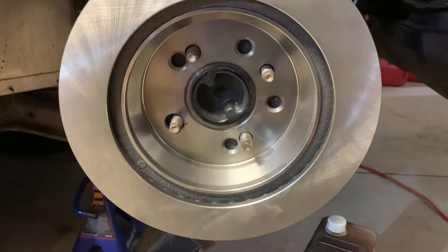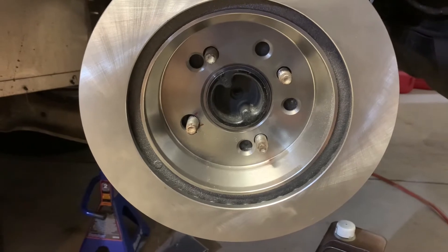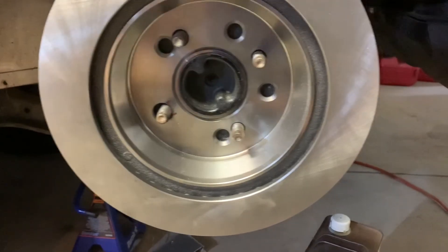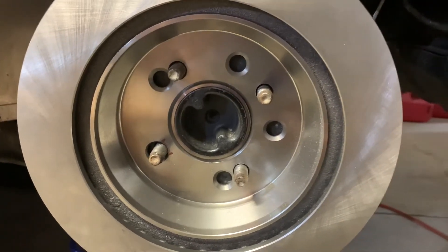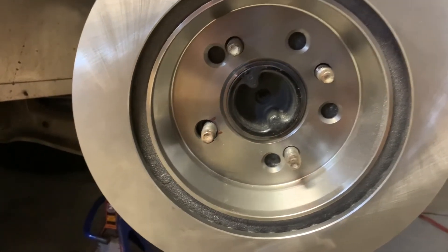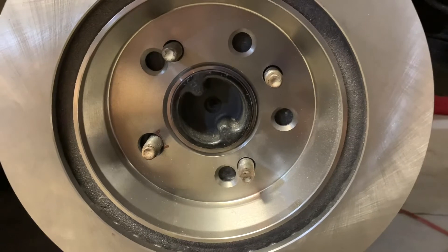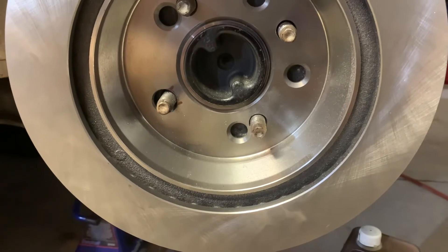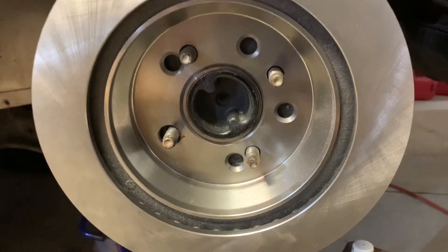After about an hour of work, I had to drill small holes first and step myself up. I used about three different smaller drill bits and then a couple of different step bits to work my way up. Here is the final result — it bolts on fine. You can see the little hub centering ring in there as well. This is up against the existing brake drum on the car. I was using it as a template to try and get everything fitted. Everything is lining up fine with the studs. So I got one down — just have to drill one more and the rotors will be prepped. Then it'll be time to start doing all the work on the rear axle as far as taking it apart and replacing all the brake parts.